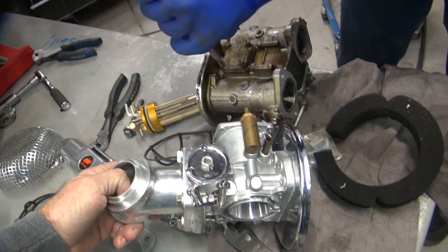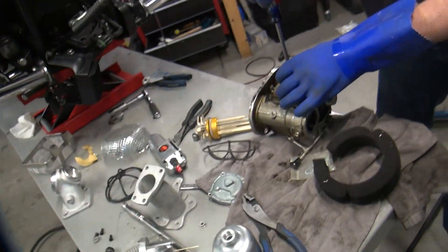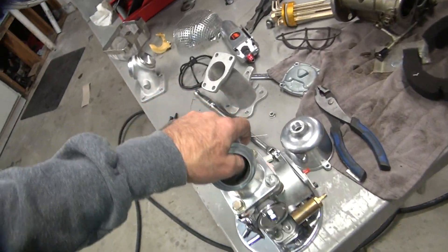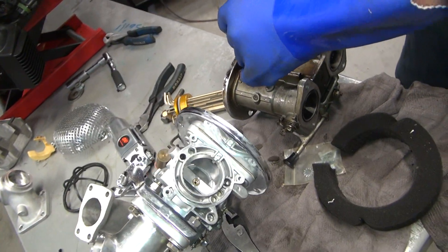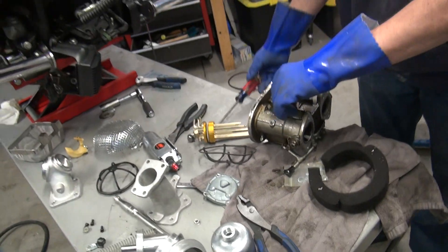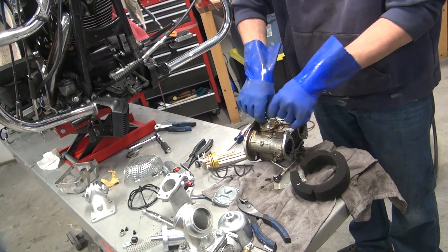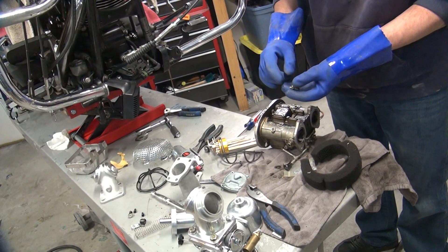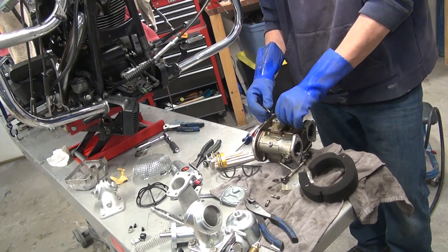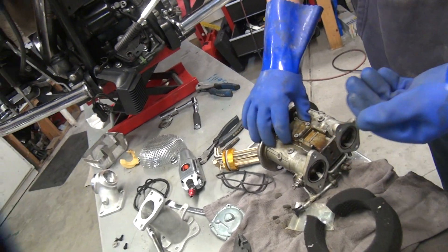And this is what it looked like before. If this thing comes out clean — this thing is nasty, man — you'd be surprised what it's going to look like when it comes out. This is our gold standard right now, what we want it to look like. The thing is clean. Do you think it cleans all the passages? The sound waves have to reach in there. If it's hard material it does a better job; if it's soft and gummy, it doesn't do anything for you. It has to be dried-up hard deposits — if it's soft, it can't be cleaned.